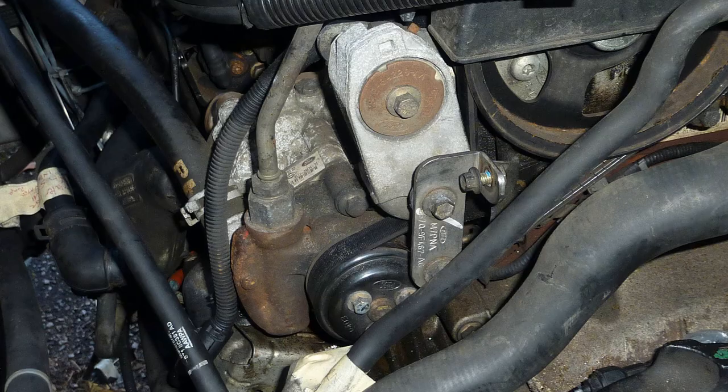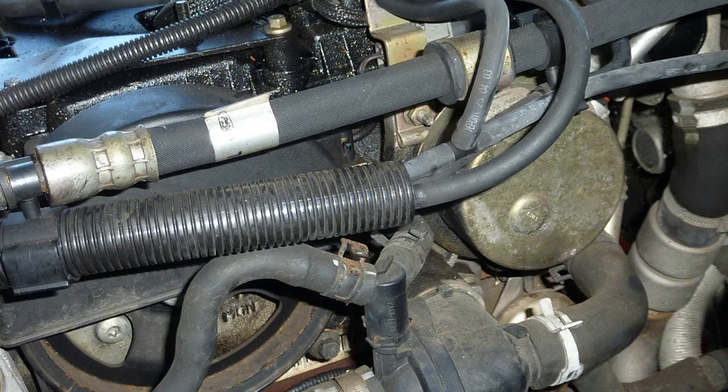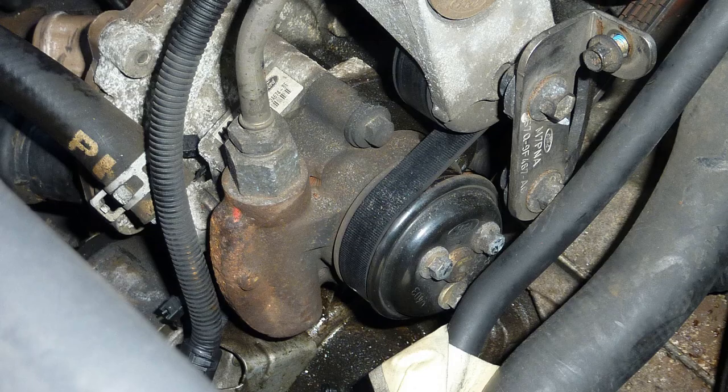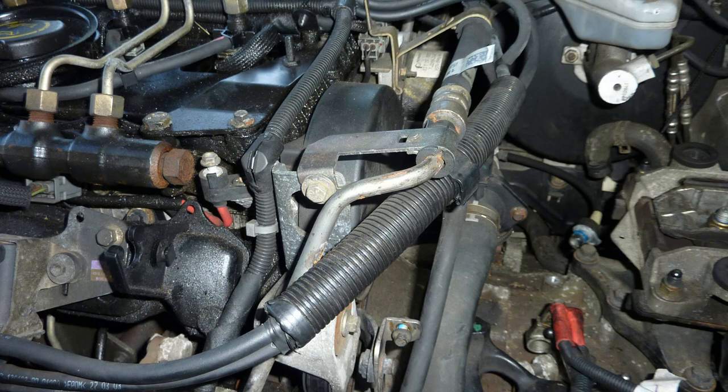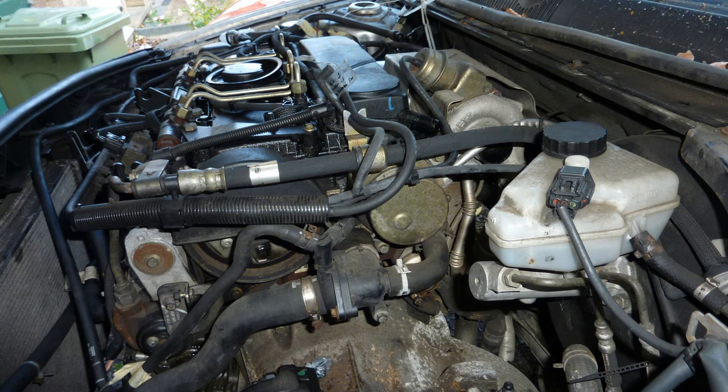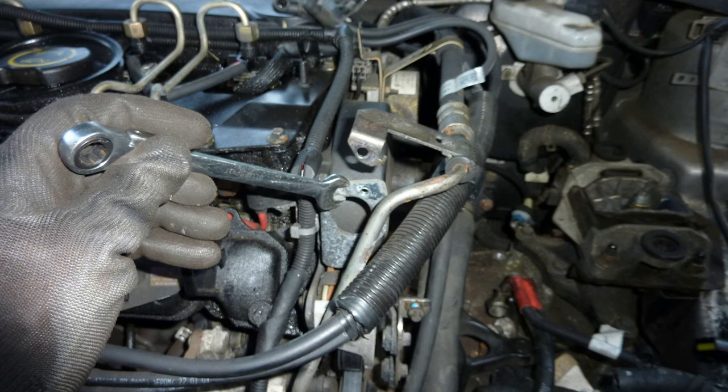Still there. So I'm thinking now, I really want to get the engine out, and the engine is lowered, not raised. So you do not raise it out of the car. Do it the way they do it when they manufacture the thing. It is possible, but much better, because your hoist won't be able to take it. You know, you're going to lift it up, and then at some point it's going to get stuck. So if you lower it from where you see it now, that's how it's naturally done. And the factory, taking some more brackets off.